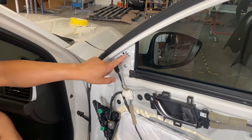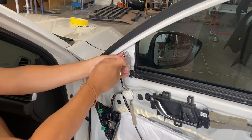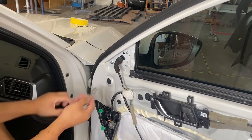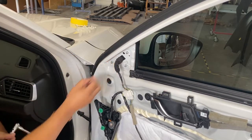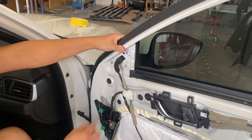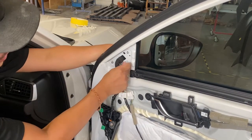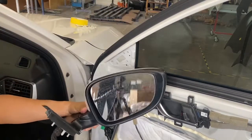Right here it's going to be 10 millimeter bolts, so use a 10 millimeter socket and go ahead and take those off. Once that's removed, go ahead and get your hand, hold the base of the mirror, and then go ahead and disconnect it just like that. Now you can grab it on the other side and wiggle it, because it's stuck on this clip right here. Push on that clip if it's stuck and then go ahead and remove it. And there's your side view mirror.